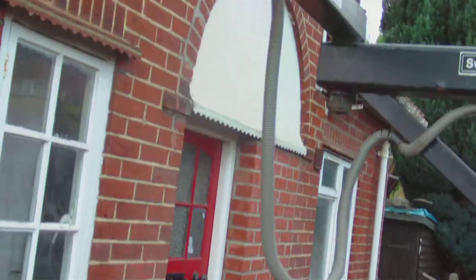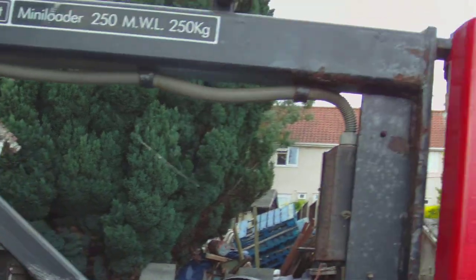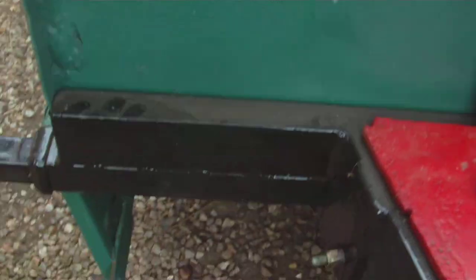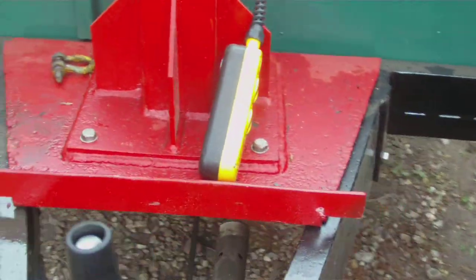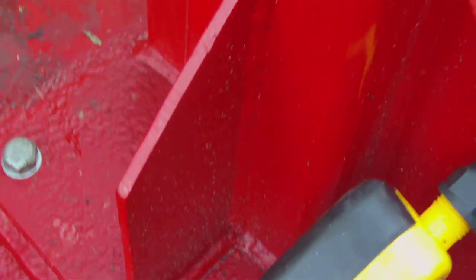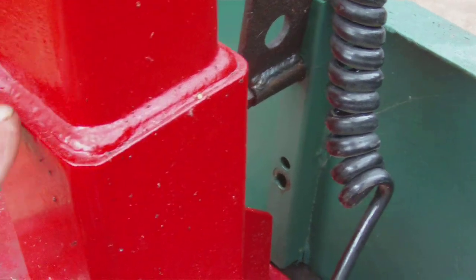You can see she moves 270 degrees on that one. Like everything, I should have painted this but ran out of time. Here's the little stabiliser leg off the subframe we made. The subframe is all fitted onto the A-frame of the tray. There were four bolts in those holes, then another bolt there and another bolt there, and the crane itself is fitted down with four bolts in the original socket. This particular socket has been welded up around there so you can't remove it.